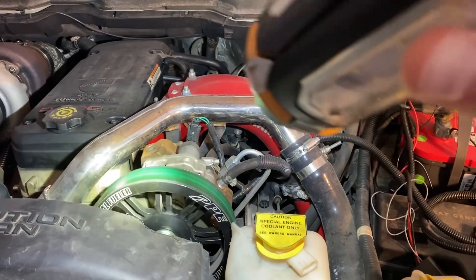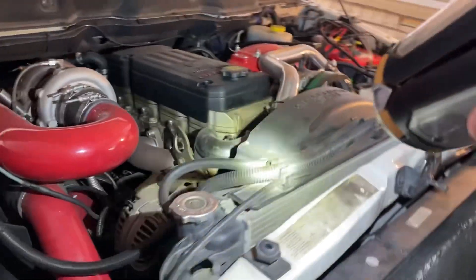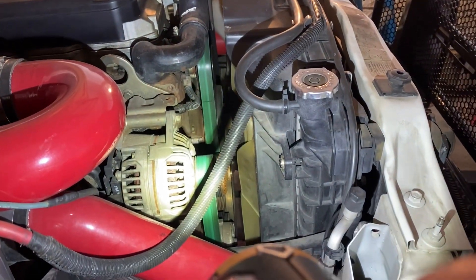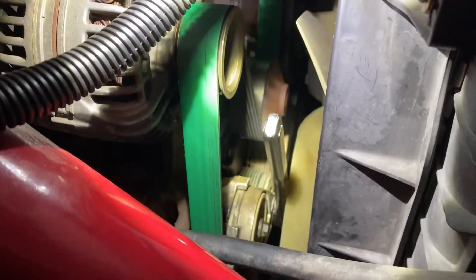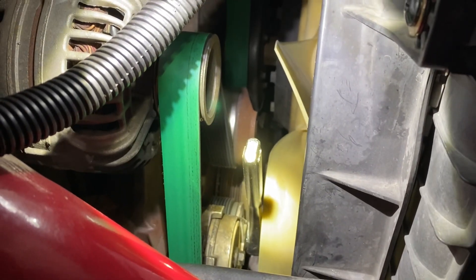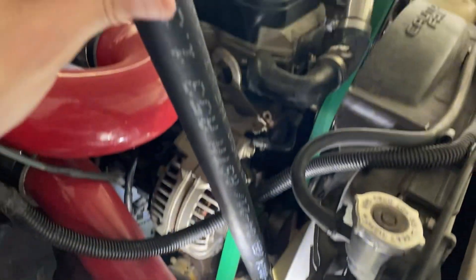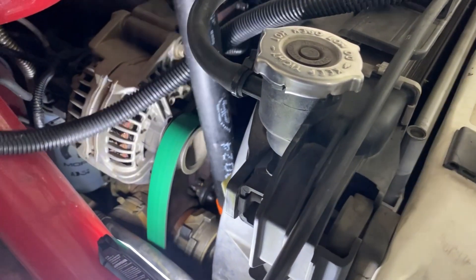Because this CP3 pump is belt driven, the kit comes with a new serpentine belt — you have to take the factory belt off and put the new one on. Here's a tip if you're working by yourself: use a half-inch drive ratchet attached to the tensioner pulley, and then attach a cheater pipe — a one-inch pipe — to extend your leverage. Just push on the top of the pipe and it releases the tension on the automatic tensioner, making the belt real easy to remove.